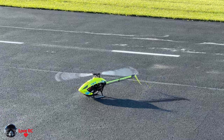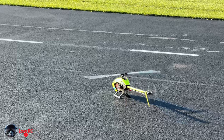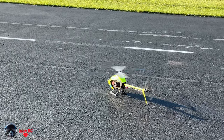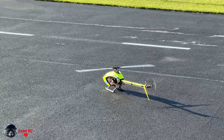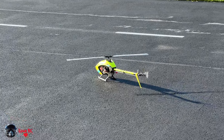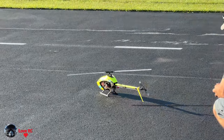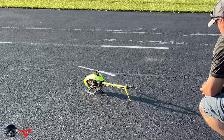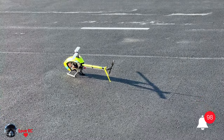I hate when they kick around like that. I'm going to have to check on the adjustment — it's kicking. It needs a little bit more right. My 360 was doing that once, so I had to adjust it a bunch of times. I'll turn it in two notches and see what it does.